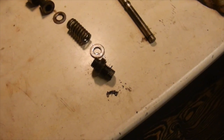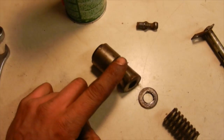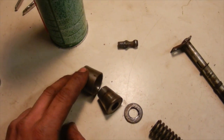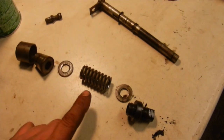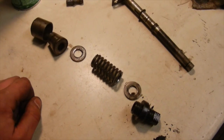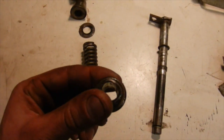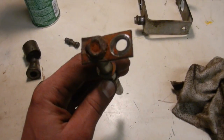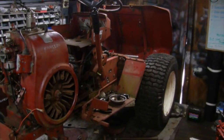I have the hydrostatic lever control all taken apart, so I'll explain it quickly. You have a tapered collar on this end — the collar is keyed and rides on the shaft so it can't spin. The receiving collar, the female end, has a flat spot on it and rides inside where the handle is for the control. As you tighten down the spring it increases tension on the collar, makes everything tighter so it's harder to push forward and back — keeps the tractor from creeping and keeps the lever stiff. If you back the spring off it's easier to move the lever. The shaft was stuck inside this piece and took quite a bit of heat to get moving again. I've got to finish cleaning up the shaft and weld the bracket back onto the end of it, then get this handle back in the tractor with the mechanism back together.